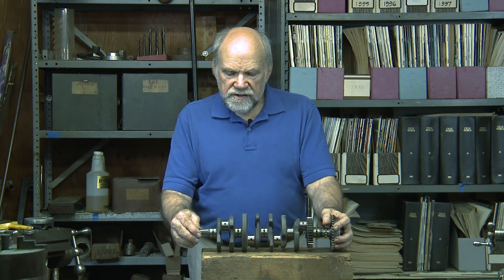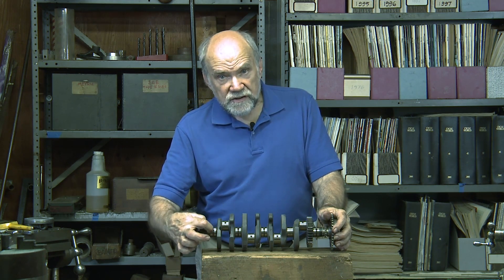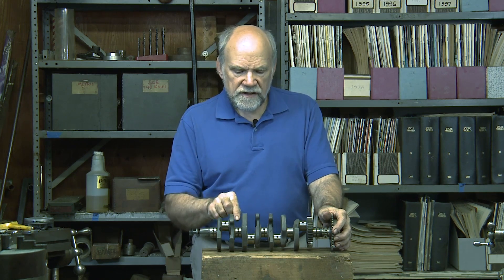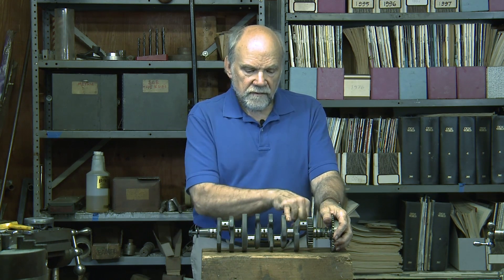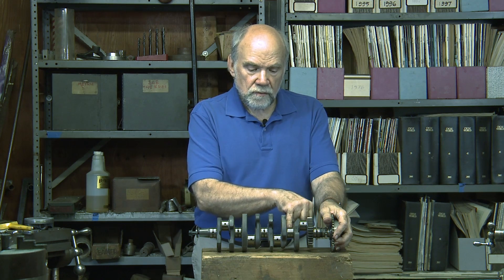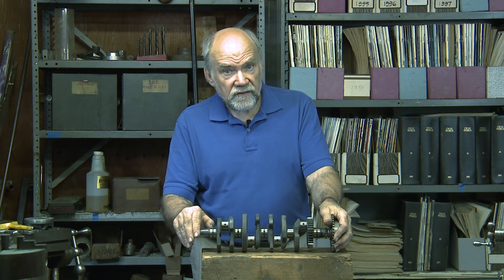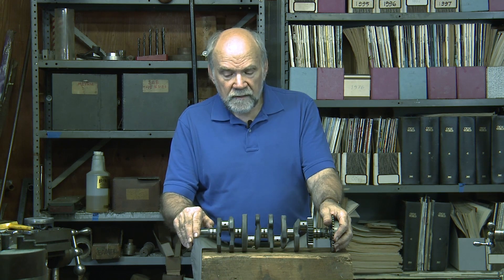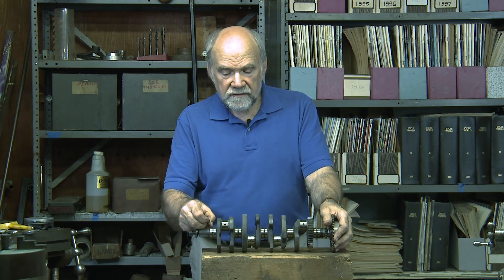What the engineers did was, first, they put a groove around the bearing shells — all the way around each main bearing that fed a crank pin. This one doesn't feed a crank pin, so it has no groove. Just grooving the bearing shells evidently didn't work for them, because they went a step further and grooved the crankshaft itself.